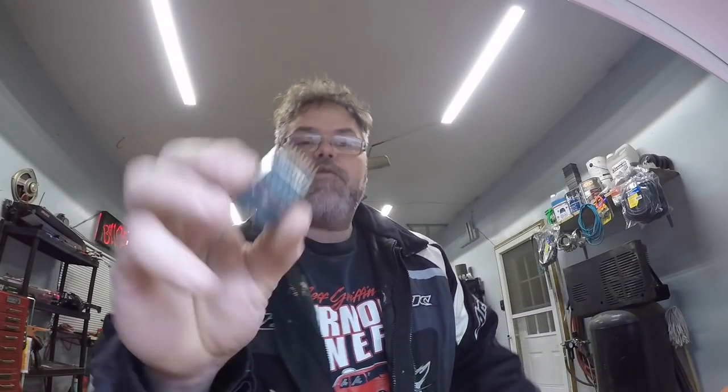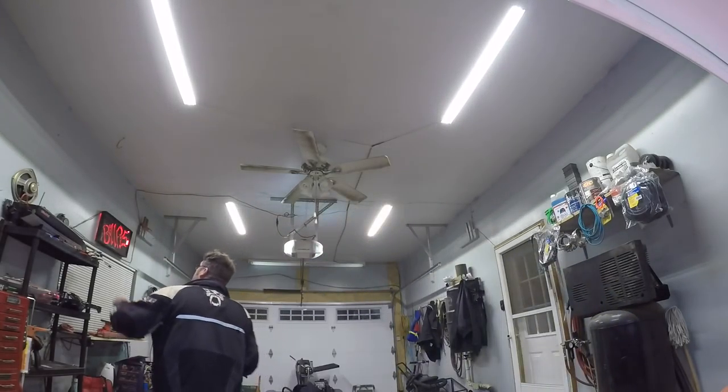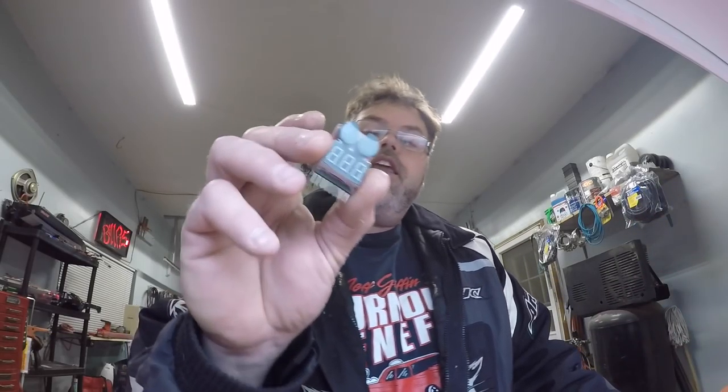I don't know if you guys with the RC cars have one of these to test your old batteries, but they work pretty decent. Take one of my 50C's that's been sitting on the shelf for a while, plug her in here and she tells you it's a 3-cell, sitting at 3.78, 3.8, 3.8 — all pretty close, one cell down a little lower. If you want a good charge and a good way to run your batteries in your RCs, you gotta get one of these. They're dirt cheap, I'll throw the link below. Especially in the boat because you're running two 3S side by side so it's 6S, and if you got one bad cell it takes them all down and fucks the battery. You need one of them if you're running all these batteries — it's a battery saver, lets you know if your battery's charged before you put it in the car.